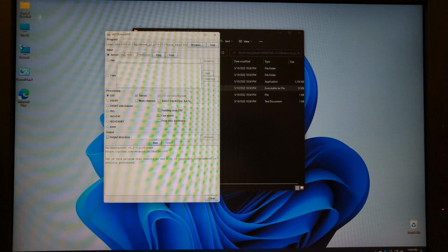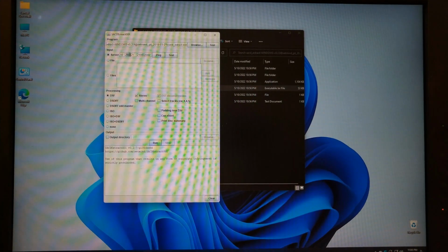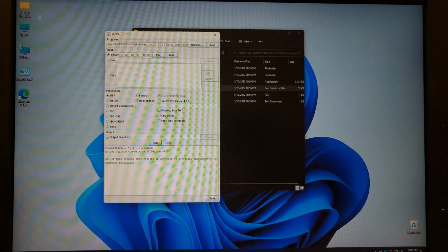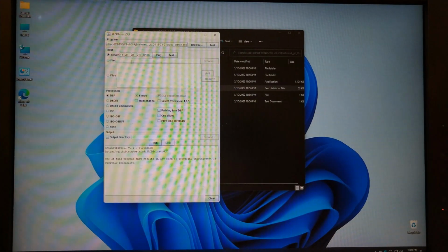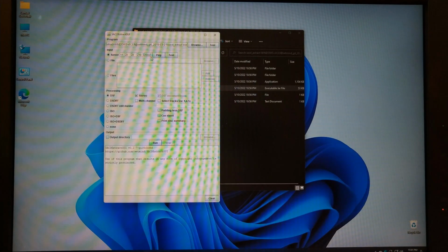Now, you will need to find the server address. And I believe I have mine memorized off the top of my head. This probably won't be the same for you unless you changed it for your network. And here's the part that I found kind of tricky, is you have to find out what port on it to use. I don't think it had this by default, so I kind of guessed and I looked on the forum and I found out that 2002 was a good port.